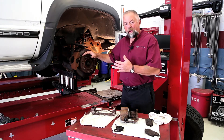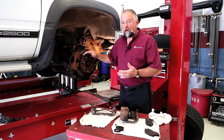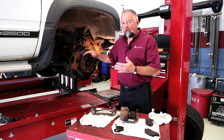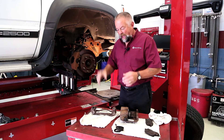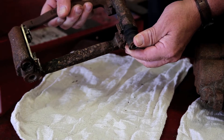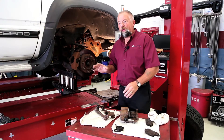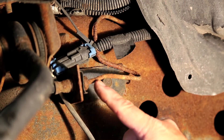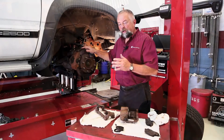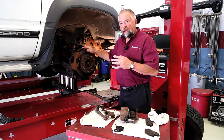Where you live may have a big part in how much time you spend on certain parts of the vehicle. If you live in the Midwest or the Northeast where we have salt and calcium chloride on the road — good for ice but bad for steel vehicle parts — it's very corrosive. It'll attack things like the caliper bracket, making those pins lock up and not allowing the caliper to slide. It's also hard on the calipers themselves, hard on the brake lines, and when brake lines finally corrode you can lose your brake pedal totally. A good inspection will include looking at all the brake line all the way back to the rear of the vehicle.